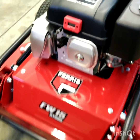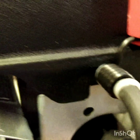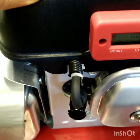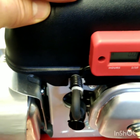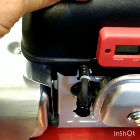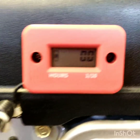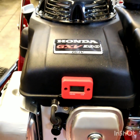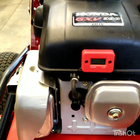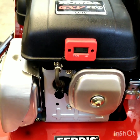It's all in place — let me get close and show you. You can see the wire running out right there. I've got my coil of five wraps. I'll probably put a piece of electrical tape around that just to kind of clean it up. I screwed the hour meter right onto the plastic, which worked out well. It's in a good location — it's out of the way but right on the front of the mower where I can get to it and keep track of the hours.